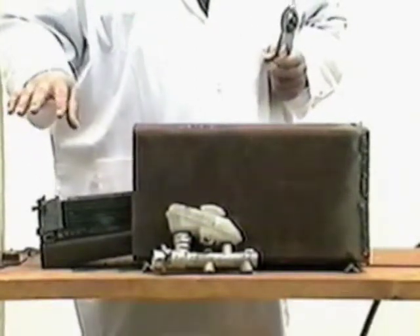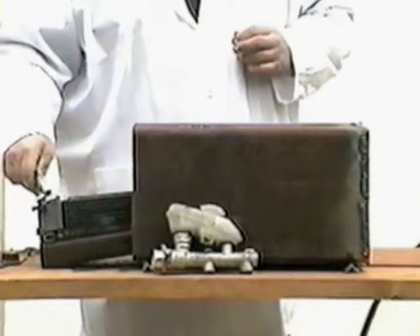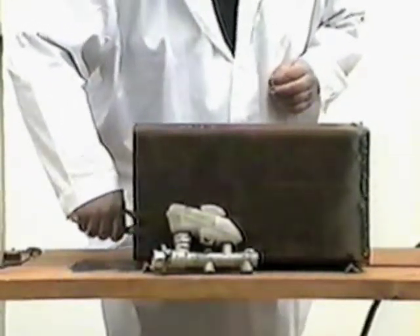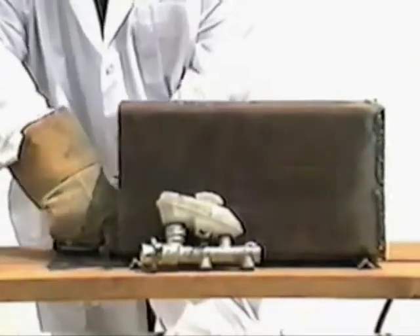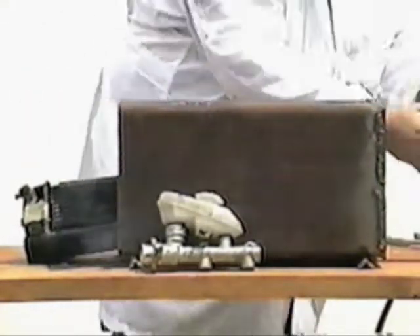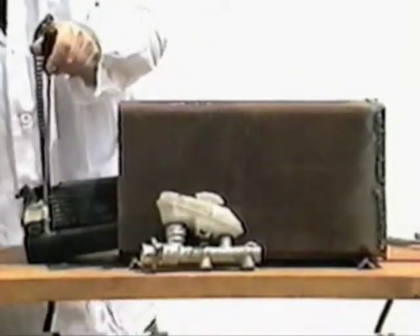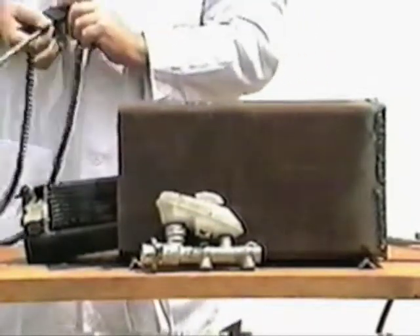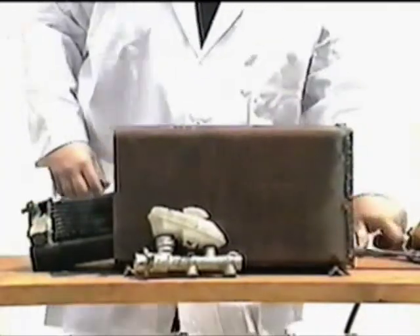Now this is a brass radiator. Normally brass will melt a couple hundred degrees higher than its aluminum counterpart, which is constructed of an aluminum core with an SMC outer shell. Normally the SMC outer shell would be consumed at approximately the same temperature as we saw the ABS-type plastic consumed. We're getting some nice destruction on that tank area. Let's pull it out for a quick measurement before we lose too much temperature. I'm running it to a temperature of approximately 625 degrees right there at that area. This is a fairly thin radiator. Let's continue consuming it, and we'll look at some of the heavier areas where the header joins the side bracket of the tank.